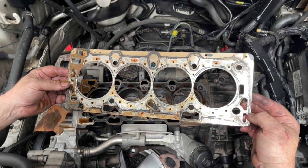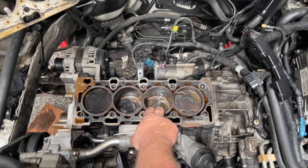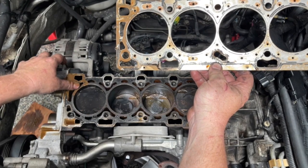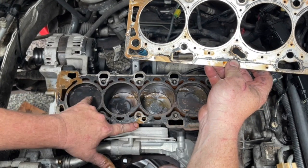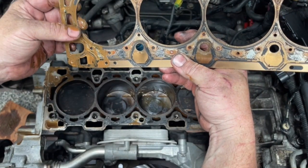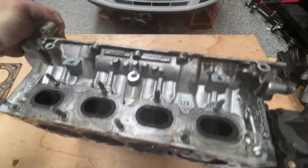I like to have a look for any obvious failure points. It's hard to see, but there's nothing that's been blown out, which is a pretty good sign. Looking in here, these two cylinders look quite clean compared to that one, so I imagine there was a coolant leak into those cylinders. We're also getting oil and coolant mixing together. I imagine there was a failure around where the oil pressure comes up through the block. I can't definitively say where it leaked just from appearance, because as you release the tension, oil and coolant move around anyway.